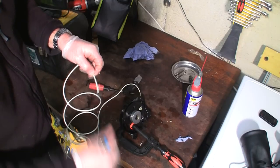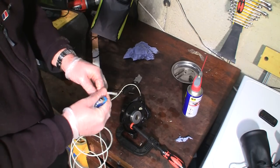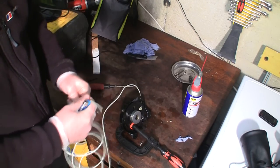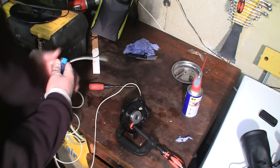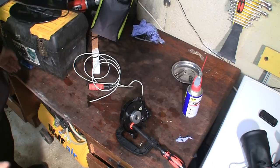One thing I'll say about this is you must put the handle on, even if you're not sure the length's right. Always put this handle on here before you take the clamp off. Otherwise, if there's enough tension on the spring, it'll just take all this right in, it won't stop. So that's like an error you learn early on. So make sure you get the actual handle on.